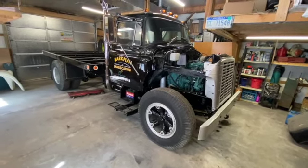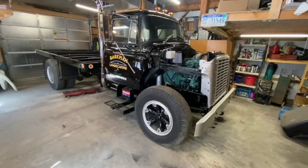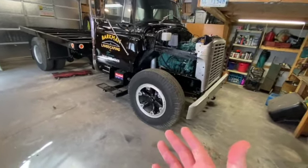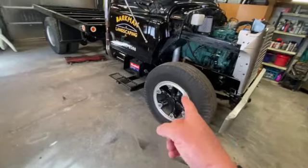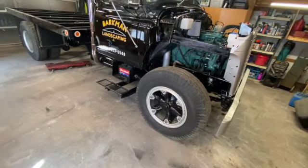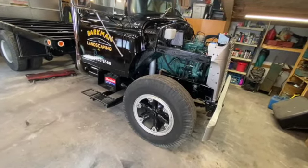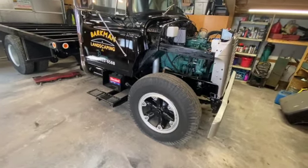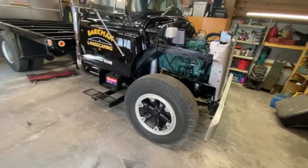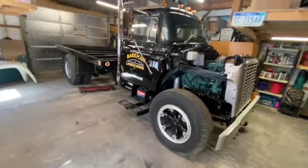But if any of you guys have ever looked for 20-inch wheels and tires, the tube type, they are expensive and rare. And if I could get away from it, I would. And as many of you probably know, on these Dayton wheel spiders, a 22.5 inch rim bolts right up, because a 20 inch is really, in terms of how it's measured, the same as a 22.5, for all intents and purposes. So that's just mulling over my options. How can I get all this taken care of?